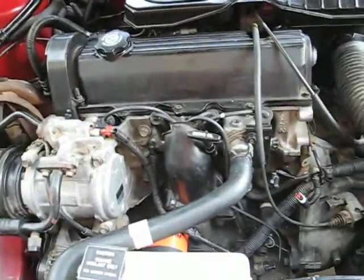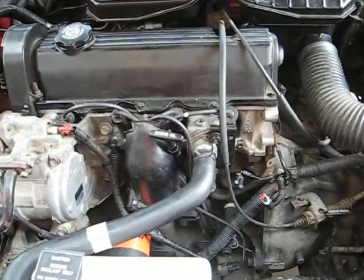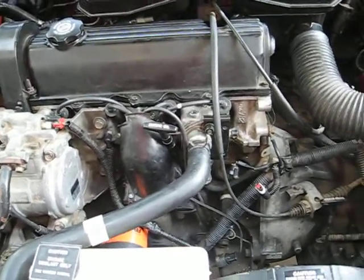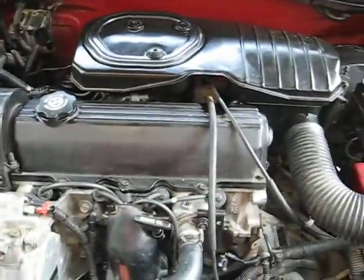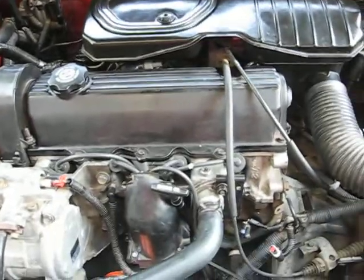Originally, this thing needed a fuel pump. There is a new fuel pump inside. I had somebody come out — they rewired the fuel pump, got power going to it, fuel pushing up into the system. But the regulator inside was leaking. Replaced that, and the car started up.